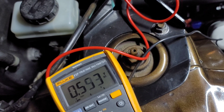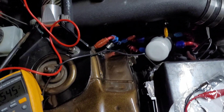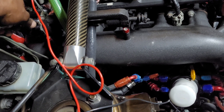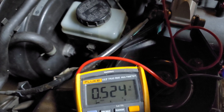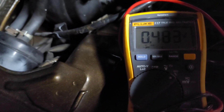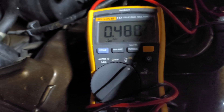I went a little too tight — let me loosen it just a bit. Tapping downward on the sensor to walk it into position. That's right at 0.48V now, so I'm going to tighten it down right there. It moves a little bit when you tighten it, but that's 0.48V right on the dot.